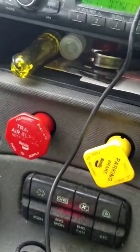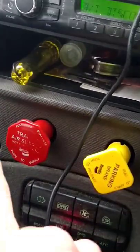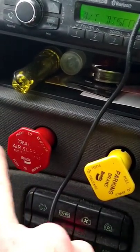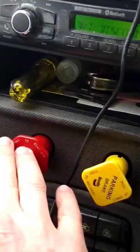If you've got a dump trailer that dumps the airbags, you need to let that thing air up for about a minute. Never leave out with those hissing. If either one of them are making hissing noises, you've got an air leak. This thing will hiss for about a minute until the tanks in the trailer air up and the airbags air up, and then that'll stop.